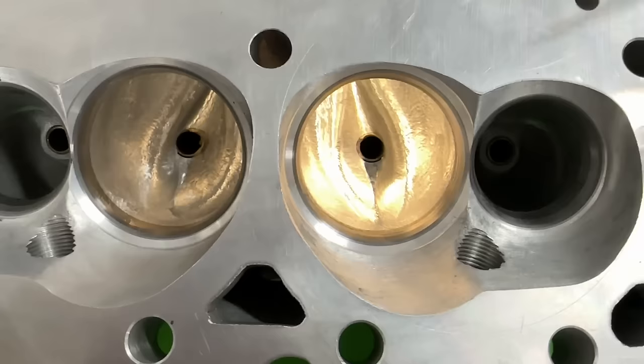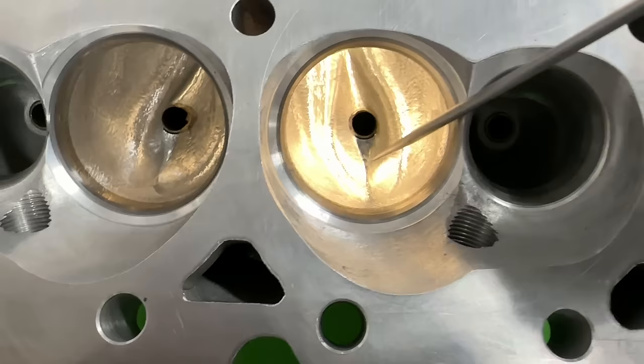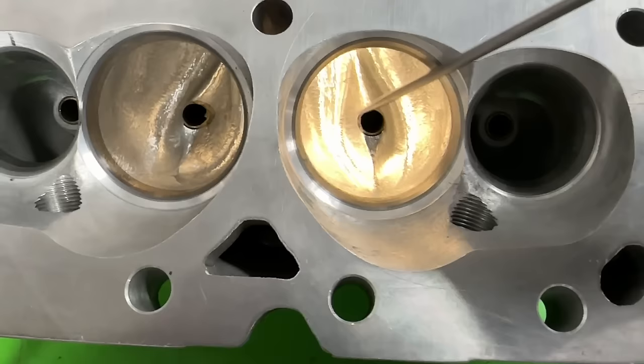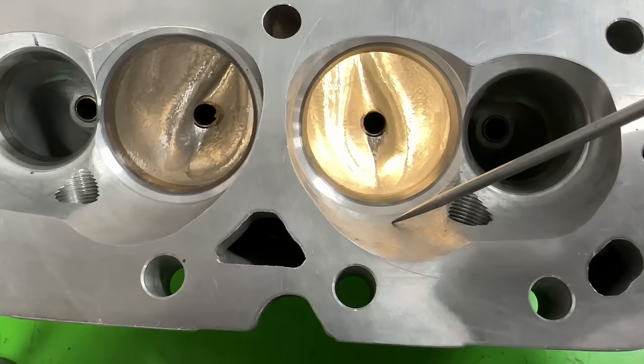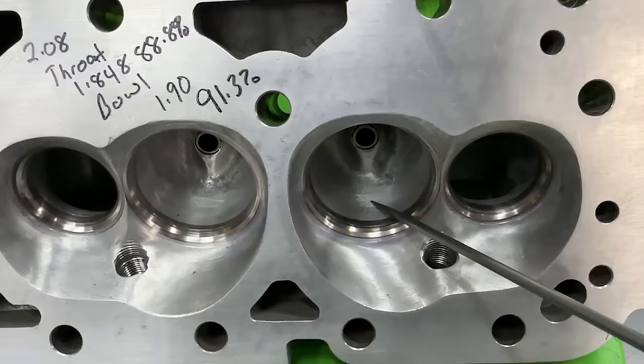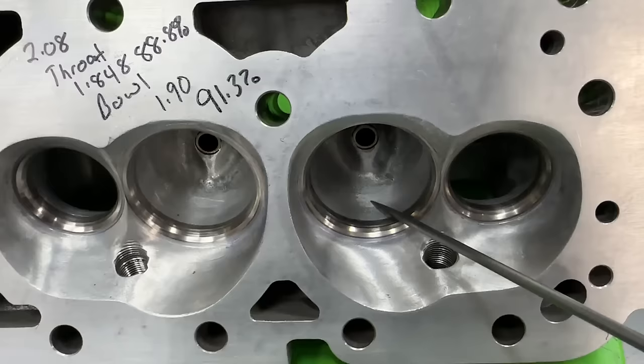Don't take it off or move it back there - that's a bad idea, and there's a reason for it. The fuel will actually try coming around, and it makes just a dead zone right in this area. By having this vein come up further, you're getting rid of some of the dead zone where fuel just kind of puddles - I mean puddle because it's suspended and falls out of suspension and traps right here. It gets too heavy, it's raw fuel that won't burn. So big drops get bigger here and puddle right there - that stuff ain't burning. That's why we want the vein to come further this way. By knocking this off and reducing it, you're making things worse for fuel. Airflow? No big difference at all.